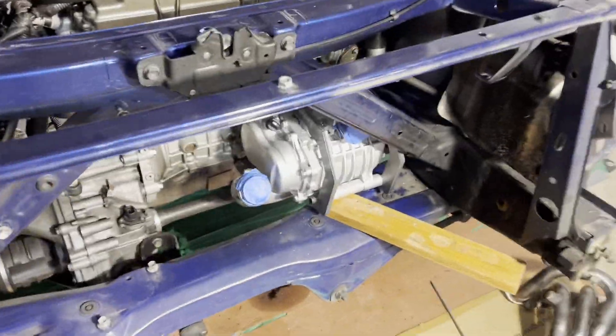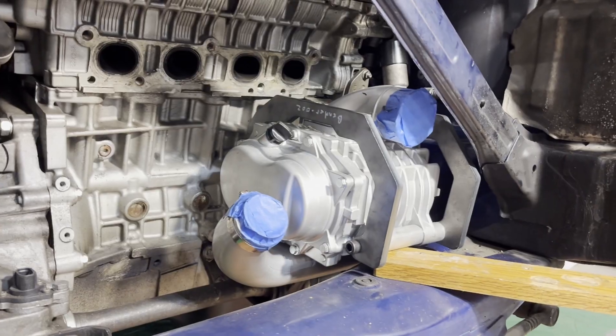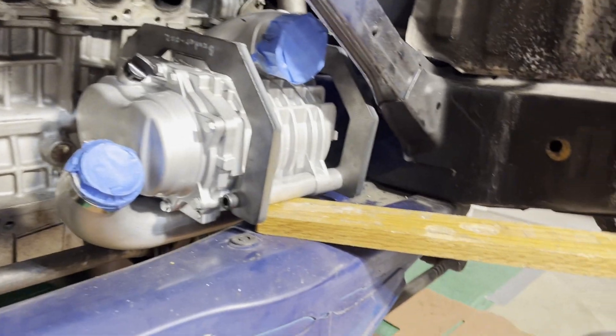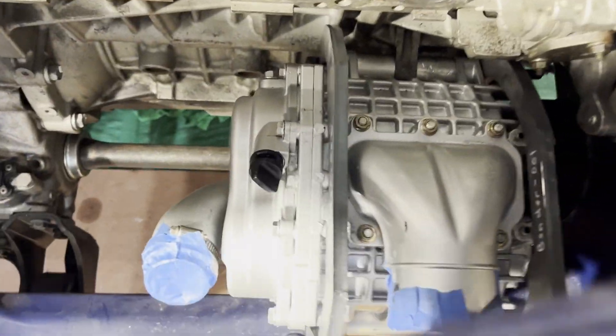This build is going to be awesome. The supercharger is almost fully mounted up — I just need to make a few more spacers for the bottom mount. There are some minor changes I want to make to the mount, so it may come back off, but for the most part the design and location are set. Now I need to move on to the next stage. To get this supercharger to fit down in here, I currently have my header off, which is laying down here — it comes straight out of the head and shoots down, and the supercharger would never clear it.